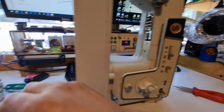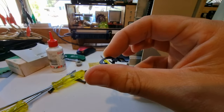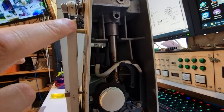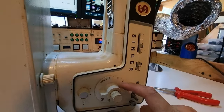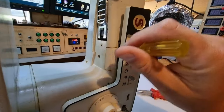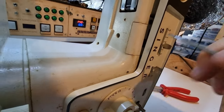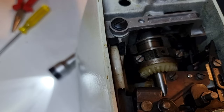I've removed two of these little spring clips — you grab those two little lugs on the end with a pair of pliers to release them. They're on the back of this front plate on those standoffs, which means I can pull this out. I haven't removed the knobs yet because I don't want to break them. There's this little service plate here I was hoping to get access to — there are a couple of screws behind there, and if I can get to this I'll have clear access through to that gear.